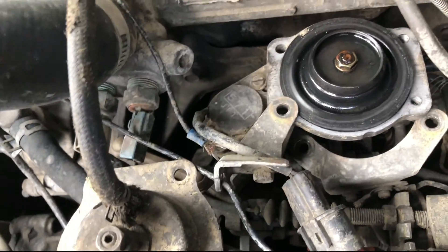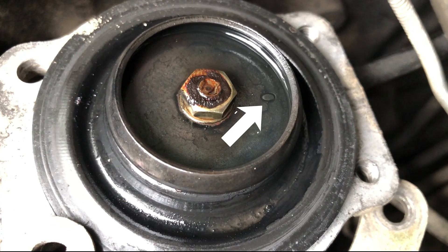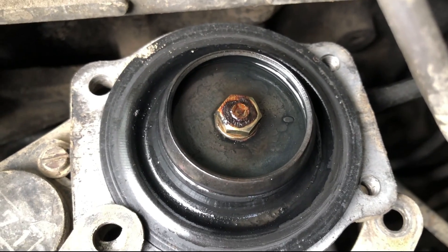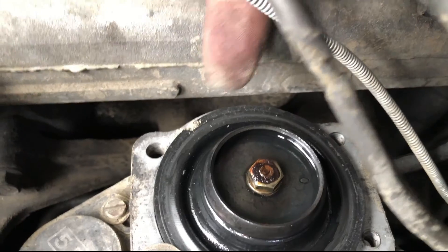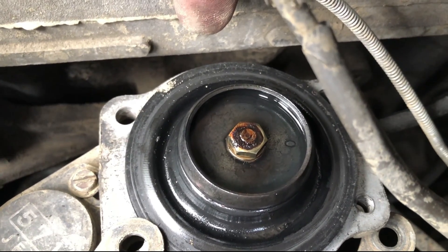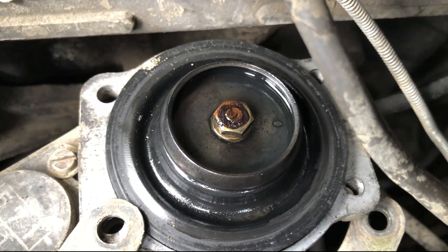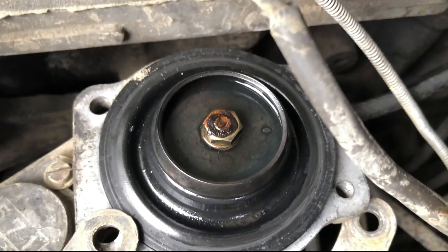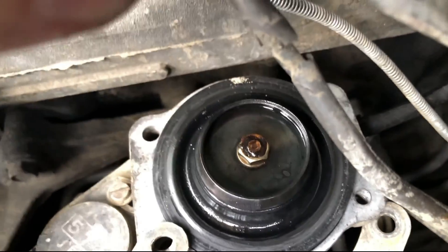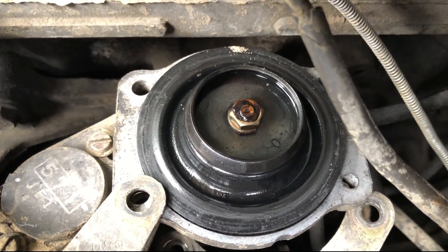There's the diaphragm — there's a mark there, you can see that letter O. This has already been turned, maybe not as much as I thought. I think it's only been turned about 90 to 100 degrees; normally the O sits here. I'm going to turn it probably another quarter or eighth turn, putting it to about 120 to 130 degrees. Actually, I'll put it so it's pointing towards that bottom-right screw hole — that gives me a reference point for position.